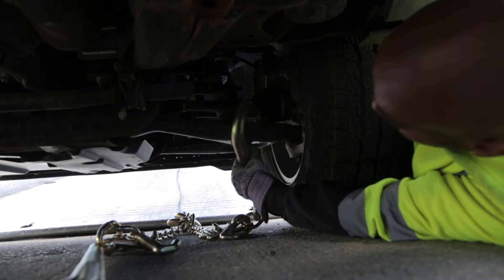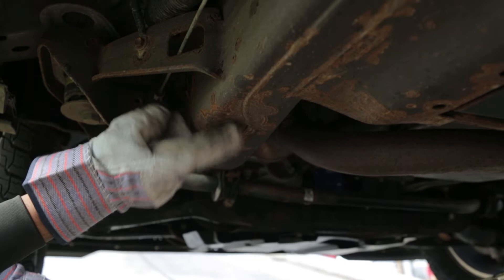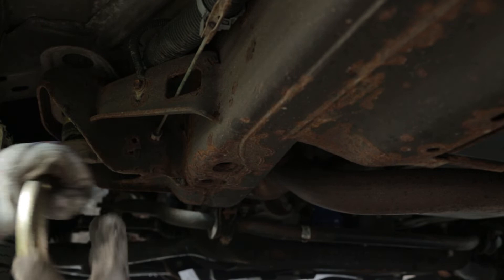Sometimes when you can't use the J because of restrictions, which I don't like to use much anyway, I like to use my frame holes. I typically use the two-ply holes in the frame rails as long as they're solid. If they show signs of flakiness and corrosion, then I won't use them at all — I'll go with my long J.